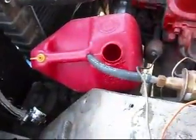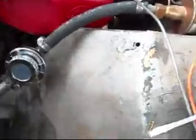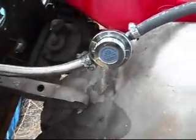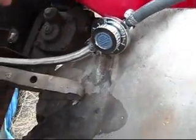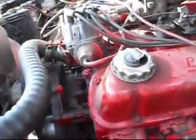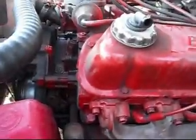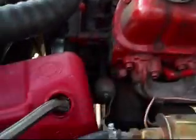I'll get it turned off because that fuel's clean — there's nothing wrong with the fuel in there. I just tried it again with that fuel pressure regulator, and I've been told that fuel pressure regulators on these Broncos aren't any good. I think I may have just experienced that, because there's nothing flowing through this thing with the regulator — the only way it flows is the carburetor feeding it. But that wouldn't make any sense because this thing wasn't starting; the only way it would start is if we put some fuel in it.